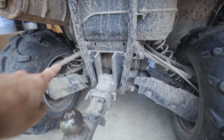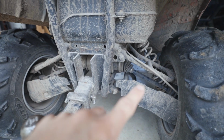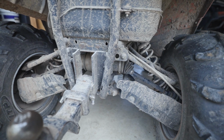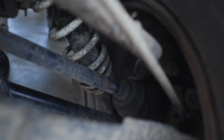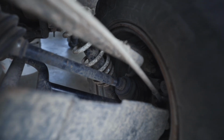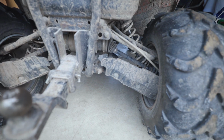On the back of this GT, the springs are up there in the front of either side, so it's going to be a little bit harder and trickier to get in there, but just remember, just jack it up, make sure you got the pressure off of the suspension. That'll make it a whole lot easier. It is on the stiffest setting, so I'm going to make it the same as the front and just have all 4 the same. But if you were towing with this, I would set the back maybe up a notch or 2.